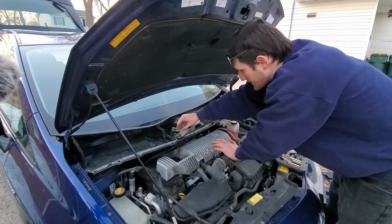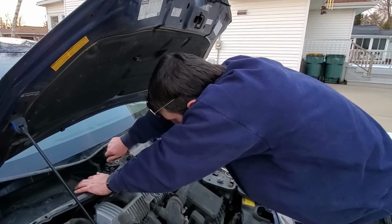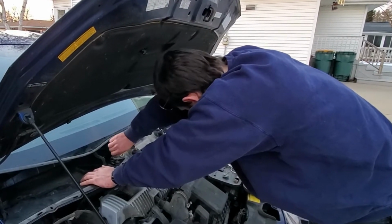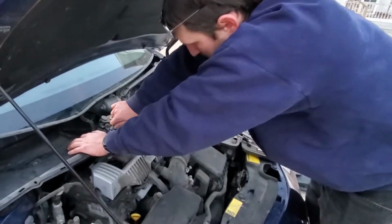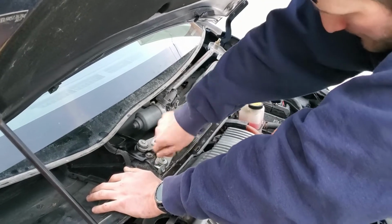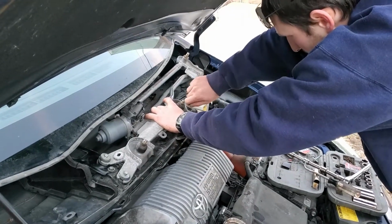So you put that rubber grommet in there, it's basically for vibrations. So right up in there, you just slide it in and start putting your screws in. Three in this one? There's four. One, two, three, and then four. So four in this one. I'd finger tighten them first, because you might have to adjust them, so don't get them too tight. You can adjust this one, so you can make it all fit.